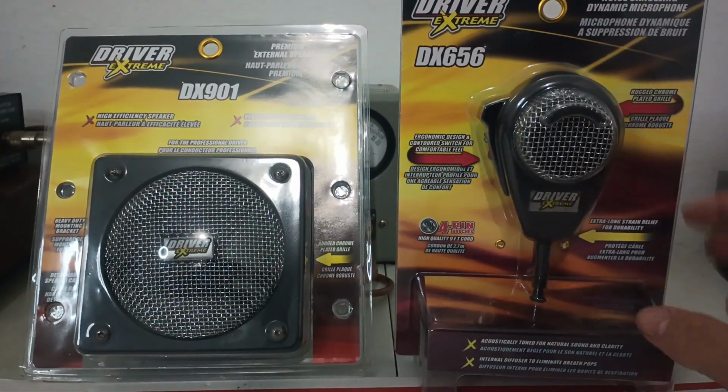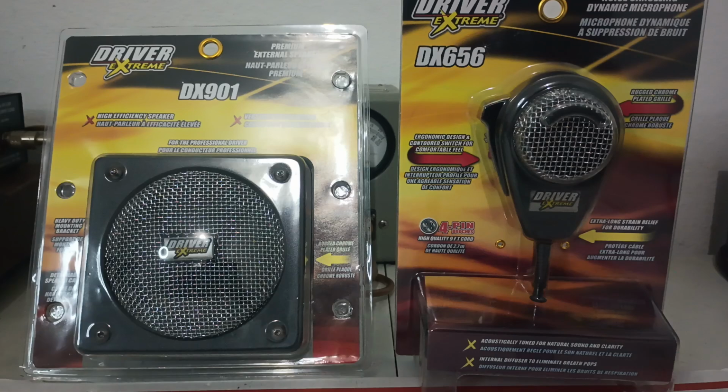Things I've heard about it that people like: they think the switch is of higher quality than a lot of the mics out there right now. I can't speak to that myself just yet because I haven't used one for any period of time. A lot of people like the way it feels in their hand, and the cord, I have also heard, is a little bit higher quality than some of the competitors' microphones. A lot of mics today, the fault that you find is in the switch, that it has to be cleaned or ends up needing to be replaced for one reason or another. I'd be interested to see how these hold up over time compared to other microphones where you have to routinely clean the switch out, or they get that scratchy sound, or they won't make good contact.